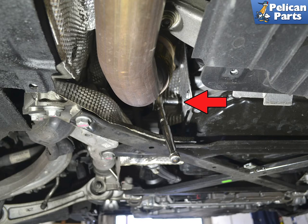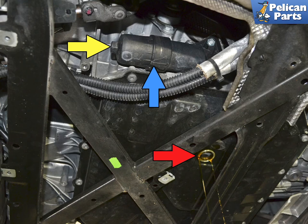If you open the drain plug and cannot get the fill plug open, you cannot drive the vehicle. Use a 10mm Allen and remove the drain plug. Let all of the fluid drain. Inspect the plug for metal, install a new crush washer, and install the plug and torque to spec.